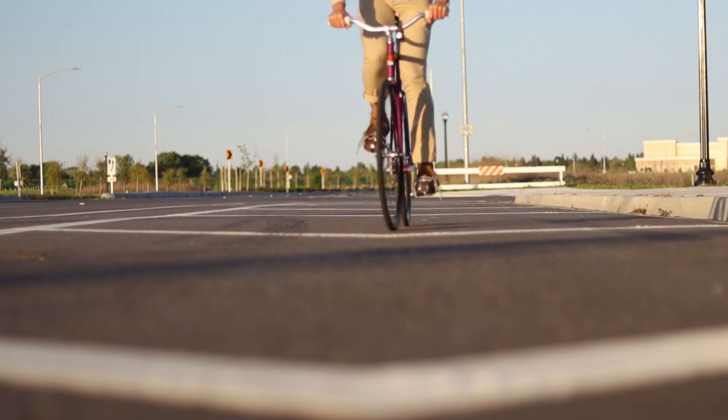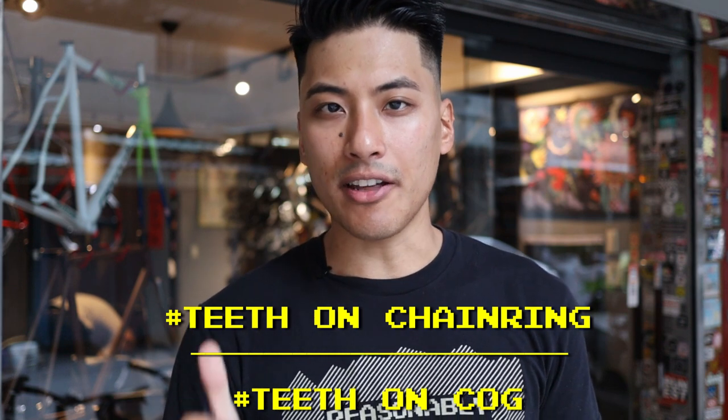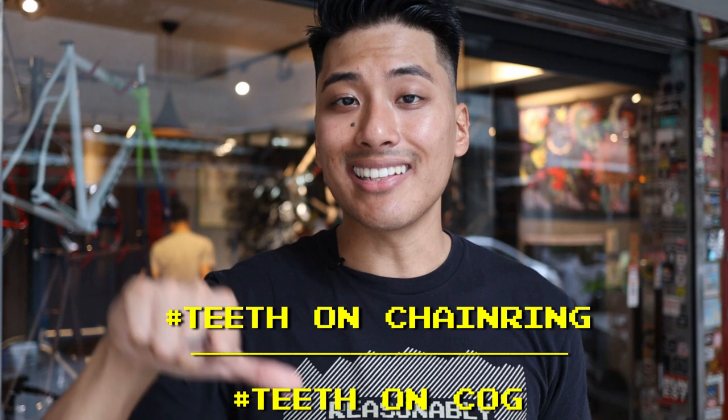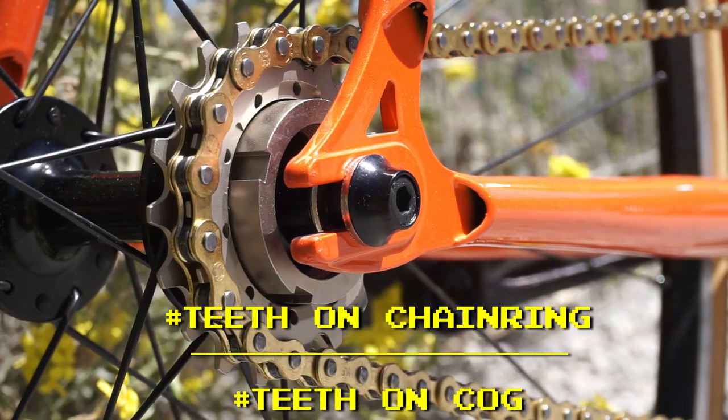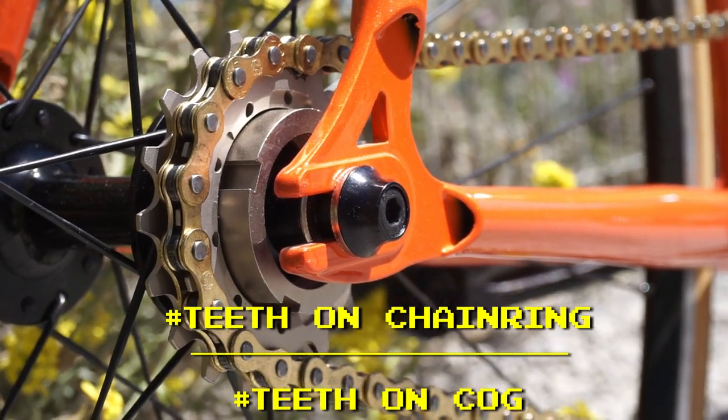I know that was a lot of information, but here's what you need to know to improve the ride quality of your bike. Gear ratios are a measure of how hard it is to pedal your bike and, by extension, your top speed. The higher the divided number, the harder it is to pedal; the lower the number, the easier it is. If you want to experiment, swap out your rear cog — it makes a much bigger difference and is more cost effective. But before you buy a rear cog, look up a skid patch calculator — you can find one linked in the description — to make sure you don't accidentally burn through your rear tire.